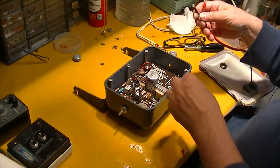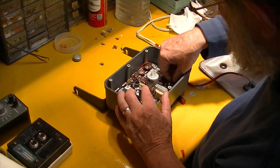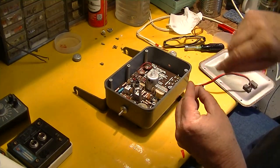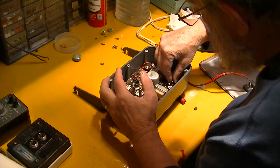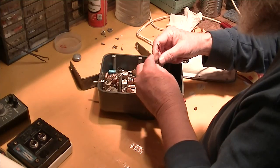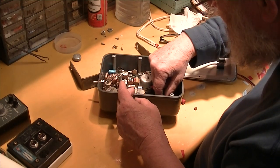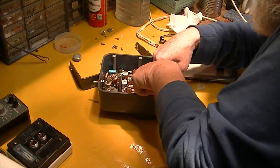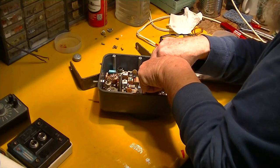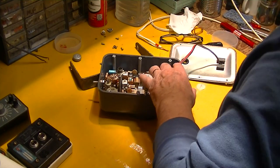I made a little power cable — I use these ring terminals because they can't pull off. These are clever little washers they put in here; these were made so you could wrap a wire around there and this would capture the wire and help keep it from pulling off, but the ring connectors are even better. So we'll use those — and boy, that looks almost like somebody knew what they were doing.